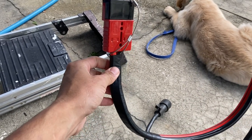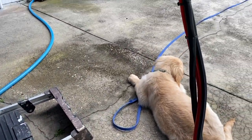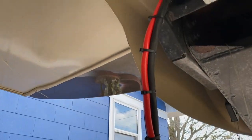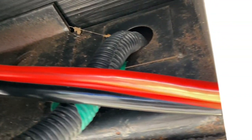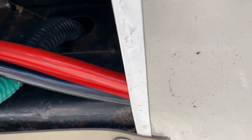Just like my connection in the truck bed, this is the two-gauge connector — the other end attached to the trailer. I ran two-gauge wiring, zip tied it tightly with my seven-pin connector so it goes up and in to where the seven-pin connector goes, and I have it routed back in between the fiberglass and the frame, which then drops down inside this front storage bay.